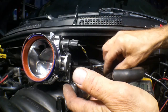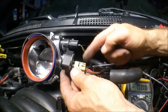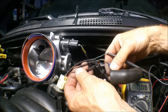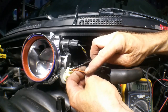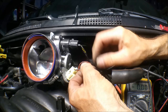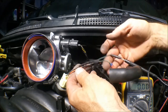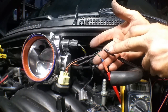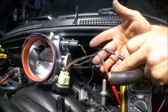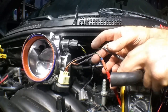I got the throttle position sensor wired back in again, back to the factory connector. I also soldered in a couple of pigtails — one off of the ground wire, one off the signal wire. That's generally your orange with a blue or green stripe; it might even have an orange or red stripe on it. Definitely not the solid orange — that is always your 5-volt reference wire. Then I placed a couple of those blue crimp-on splices on there, and placed a piece of orange heat shrink — or red if you can find it — over that. That way you know that's your positive. And I put a piece of black over the other one. When you shrink it down, your probes go in there, and that piece of heat shrink on the very end helps hold those probes in place.